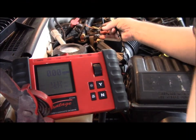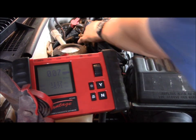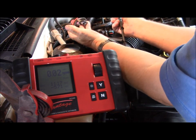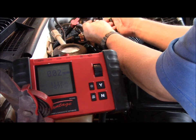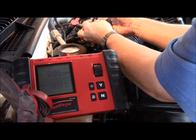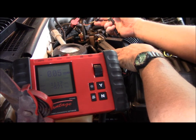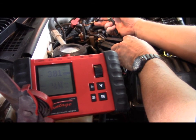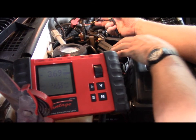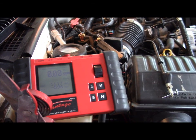Alright, it says if you don't have the modulation on the ignition coil, which we didn't, to disconnect the terminal from the ignition driver, white wire, front probing, but just touching it, not to spread the pin. We're supposed to see 1 to 4 volts while cranking. Check out the Vantage. So 3.57 was kind of a constant reading there, so that's good. Now what?